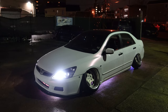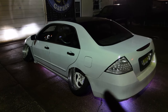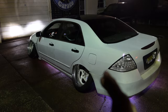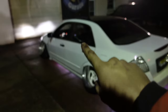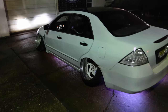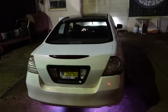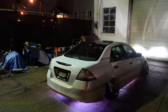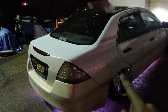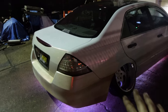And just like that, we are back on the floor. From backing it up, I do have to bleed the brakes more. There is a little bit of squish in it still, so I only bled the rears. Some air must have made its way to the front during all of that leaking fiasco. So I'm just gonna take it nice and slow going home. Luckily, we won't have to deal with that wheel getting black anymore.